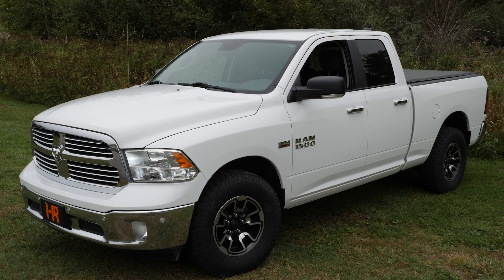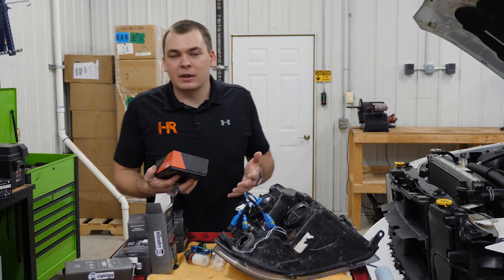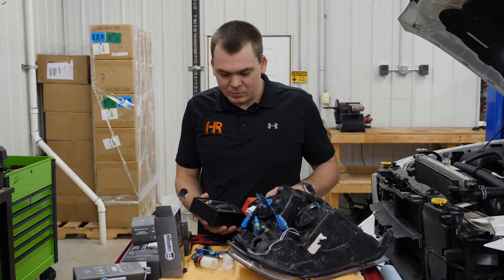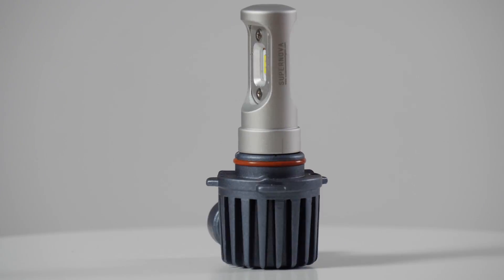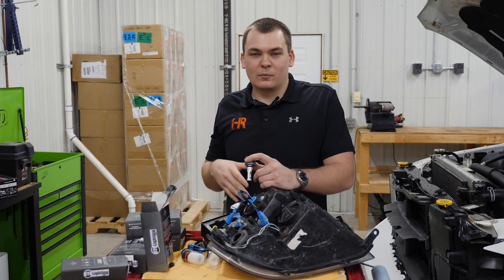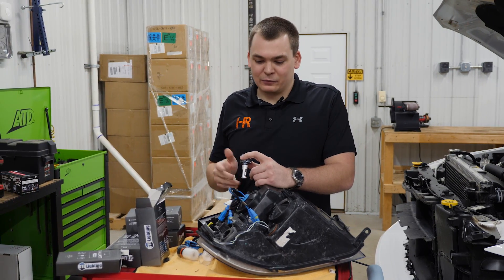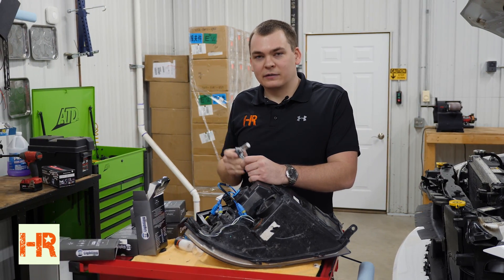The high beam is the exact same process. But one thing to note — a lot of people on these Ram trucks do an HID low beam for maximum brightness since the low beam is always on, and then an LED headlight bulb in the high beam. The thing about HID is when you turn it on, it ignites the gas in the bulb and it takes three seconds — sometimes more, sometimes less — to reach its maximum brightness. You can see why that might be a problem if you encounter traffic often, having to shut your high beams off and wait for them to warm back up. LEDs are instant on and off, and LEDs have come so far that they're almost as bright as HIDs in the high beam.